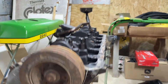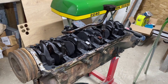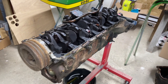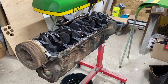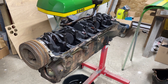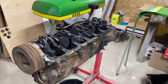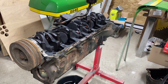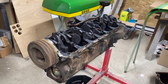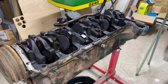It's going to get bored anyway. I'm not really sure what I'm doing for pistons and rods yet — probably going forged on pistons and rods. The problem is there's no forged pistons available for the 300. There are forged rods available, but you can't get pistons that'll fit. So I may end up boring it over to another size, like 50 over — I think you can get forged pistons for that — and you'd have to get different rods and end up bushing the pins. I haven't gotten that far yet, but I do plan on going with forged pistons and rods in this build. I want to build it for more boost than what I'm running right now.